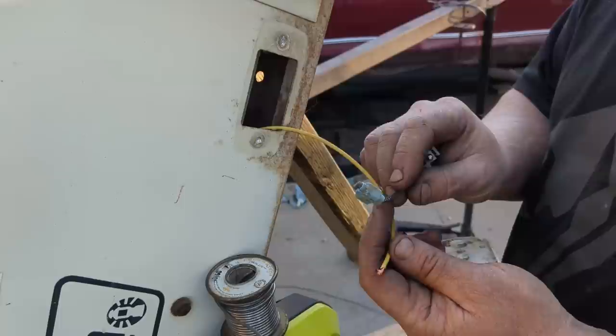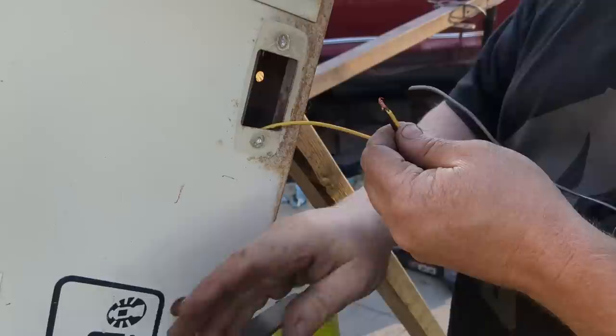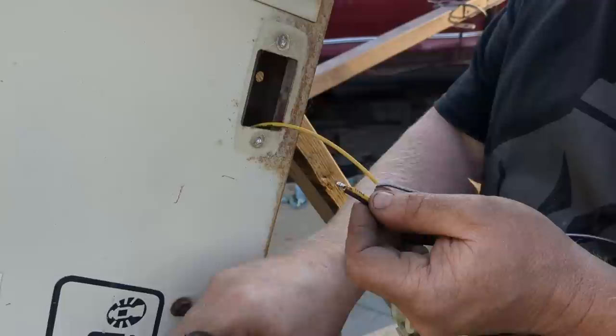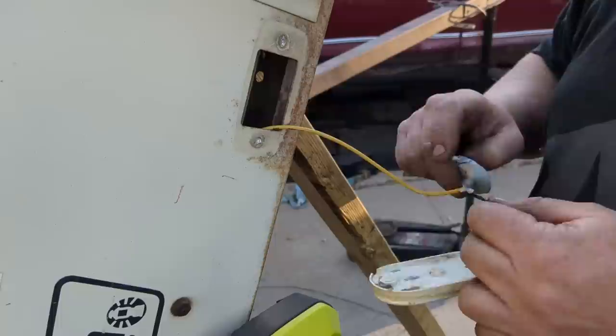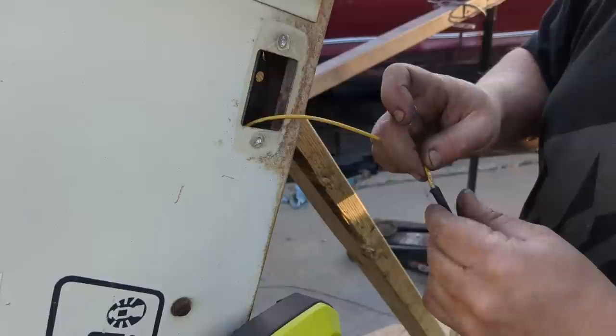See these quick crimps — if you put one of these on your trailer, you're just asking for trouble. Six months, a year, two years, they will fail and ruin both wires. Just got the wires twisted together using some electrical solder — rosin core. To be perfect, the solder joint should look shiny. Should not look dull — if it looks dull, you had a cold joint. Always fold it in half if you want it to last. This is dielectric grease — prevents moisture. It's essentially silicone grease; you can also use Vaseline. It prevents moisture from tracking down and corroding the copper and ruining the connection.